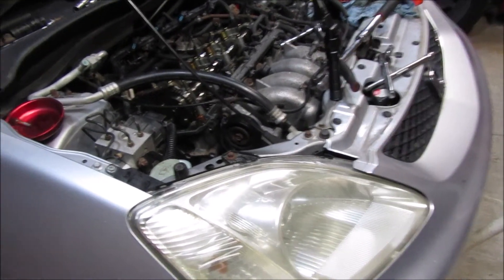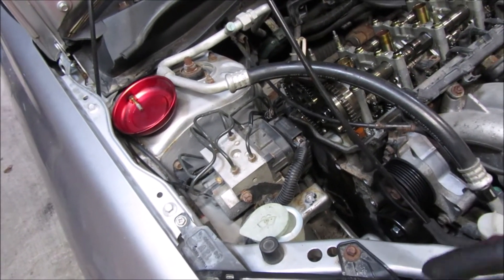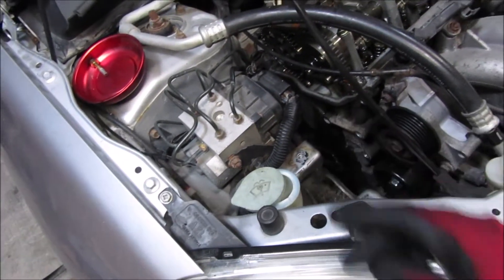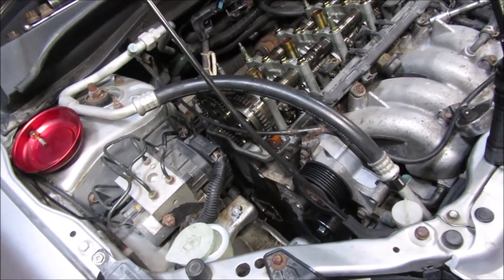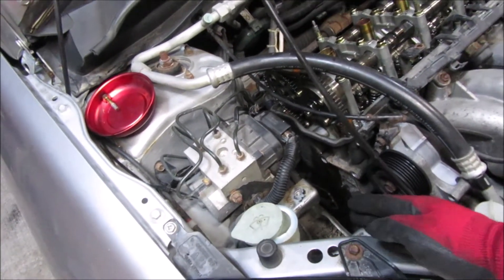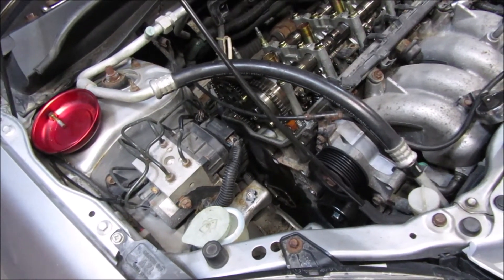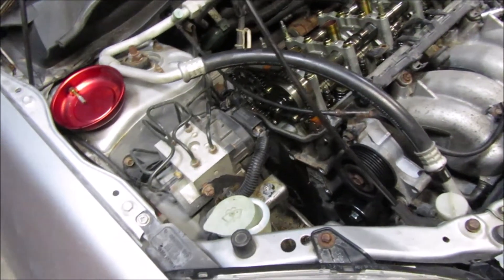I'm skipping some steps — I've got the removal of this stuff in another video, linked in the description. Right now I've got the engine mount and engine mount bracket off the engine. You're going to need a couple of different wrenches — a ratcheting wrench as well as a ratchet and a couple of extensions. There are a couple that are really tight but you can still get them out; most of those are 14mm. Now I'm going to start taking off the timing cover bolts. It looks like a real pain because even with all this off, you can barely fit your hand in here.